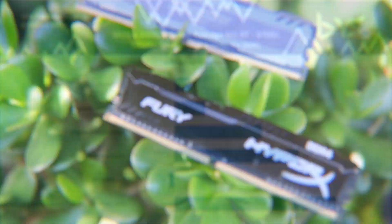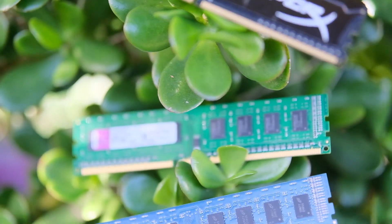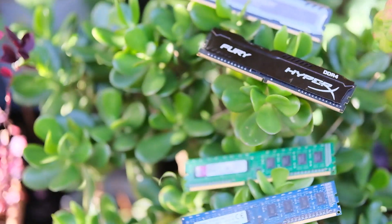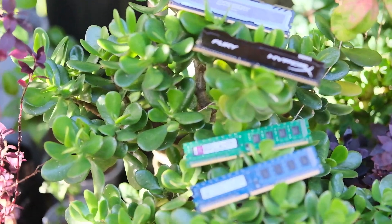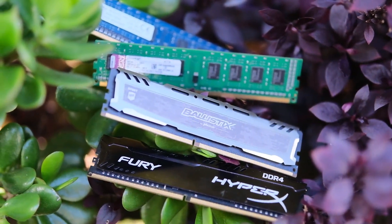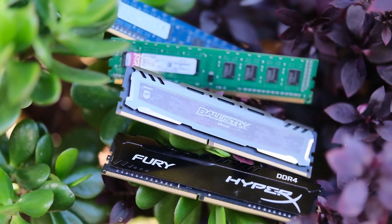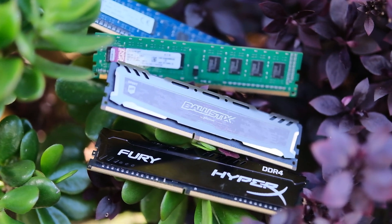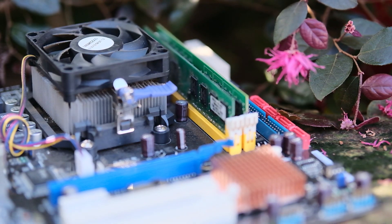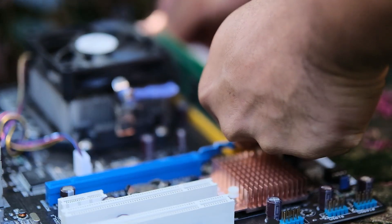What are my final thoughts? I can probably make a case that trying to optimise your RAM might have a benefit depending on your CPU. My 3700X is very picky and was hard to get right for RAM overclocks on both the 3433 profile and even the Samsung B-Die one as well. The primary timings are easier to tune but some of the benefit from RAM overclocking might actually come from secondary and tertiary timings, which is more difficult to work with for the first time. For people trying to get the absolute best out of their systems, it would be beneficial to find RAM that is easier to work with, such as Micron Rev-E or Samsung B-Die on an AM4 system.